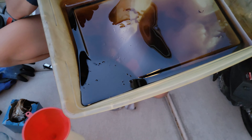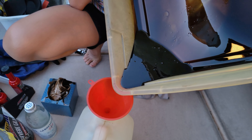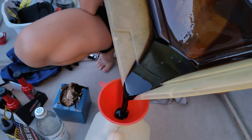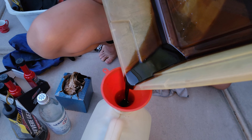You don't want to overfill because if you overfill it and tilt the scooter on the side, it can smoke and actually burn oil. We got our old oil and flush going into the drain pan — we're going to dump it out. This is all our carbon buildup. This cute little guy's got exactly 11,000 kilometers. So that's the old oil with all those carbon particles.